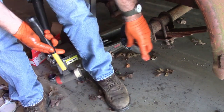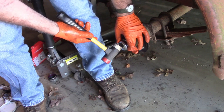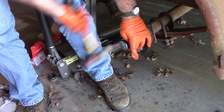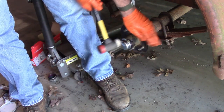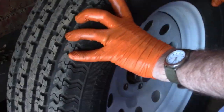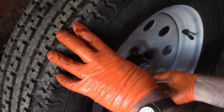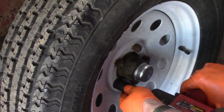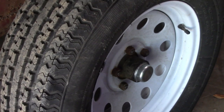To get the little caps on — it can be a booger. The easiest way is to hold them back here and start tapping on the edges, being careful not to get your fingers smashed. Just get it seated really good and you're done. Put your lug nuts back on. That's got our new trailer bearing installed — hope this was helpful to you, thank you for watching.